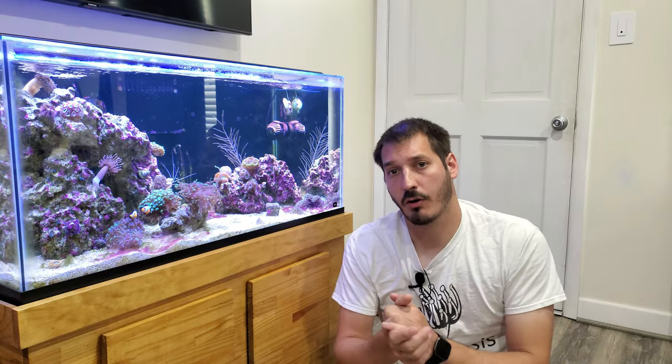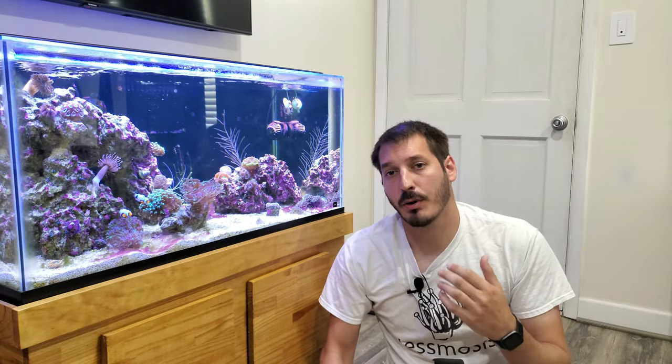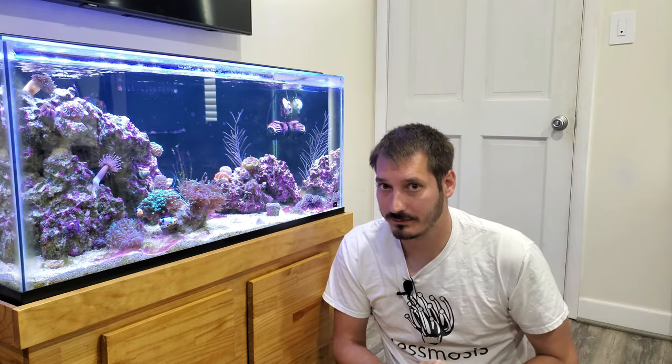Today I'll be going over the current USA 1050 gallon per hour wave pump. I will be telling you guys how to take it apart and how I clean it.